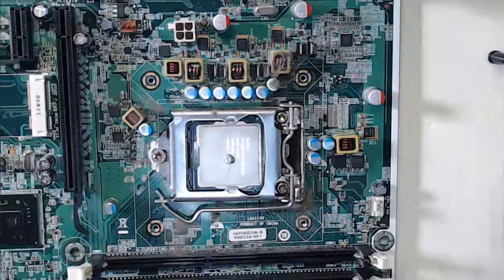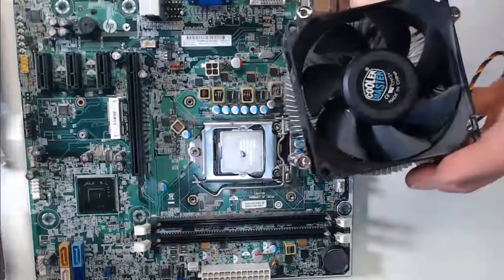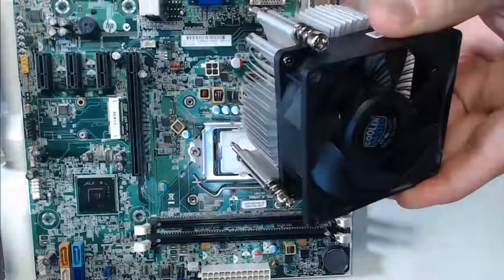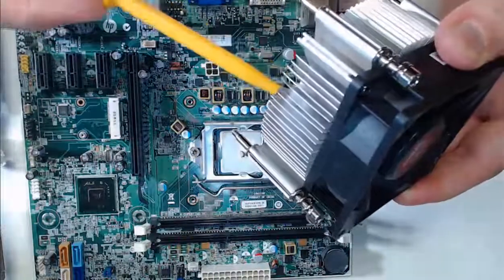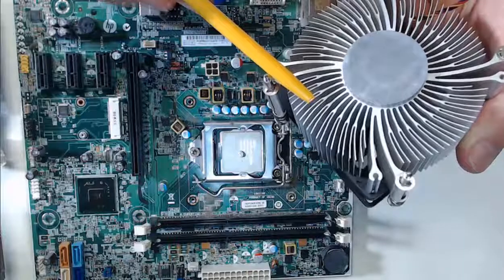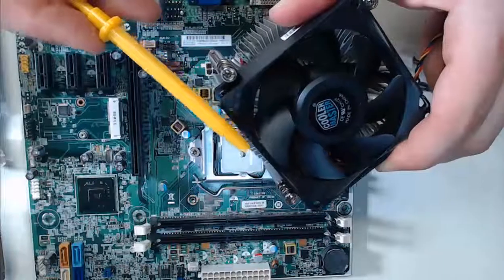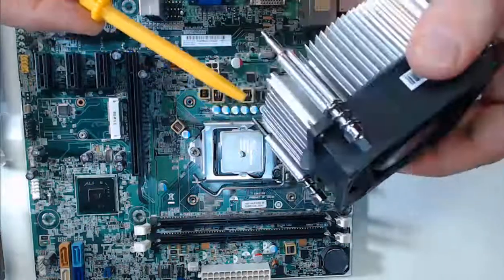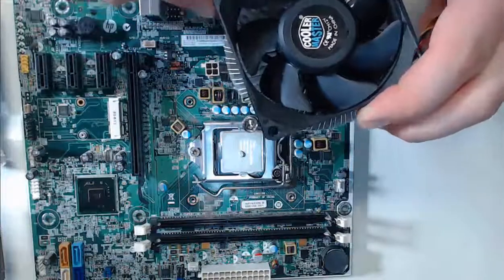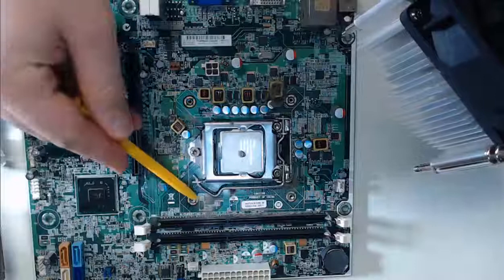To keep the CPU cool and prevent it from overheating, we are going to install a heat sink for step 5. These commonly have a fan attached to them, but not all do. These fins we see here are going to absorb the heat from the CPU and have slots for airflow to move in between. The fan on top of the heat sink will help draw the heat away and cool the fins, allowing them to absorb more heat from the CPU. As we place the heat sink on the motherboard, it may take one to two attempts to position it correctly over the screws that surround our CPU.